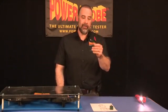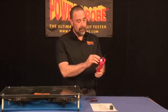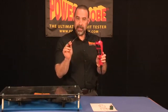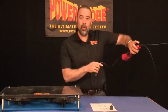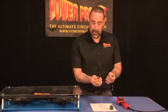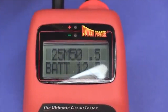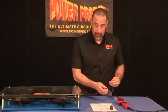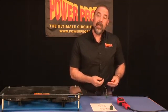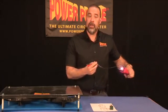Now we're going to discuss the relay test harness that you've located in your case. Let me show you how to connect it. First, we're just going to lift up on the tab and plug the harness right in — that's how you connect it to the hook. Let me show you what it's doing so you understand. We're going to connect the black harness to the green harness, and you're going to see the green negative illuminates. When we connect the red to the black, you can see that the positive illuminates. So basically, it's a continuity tester.